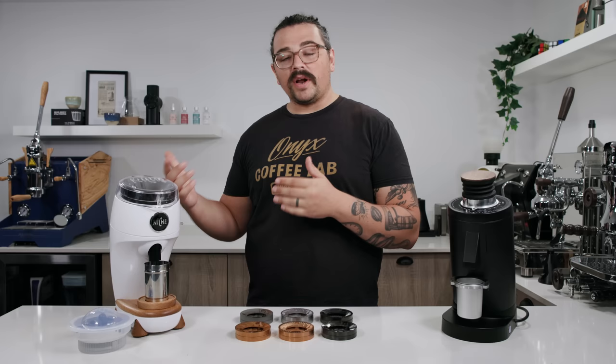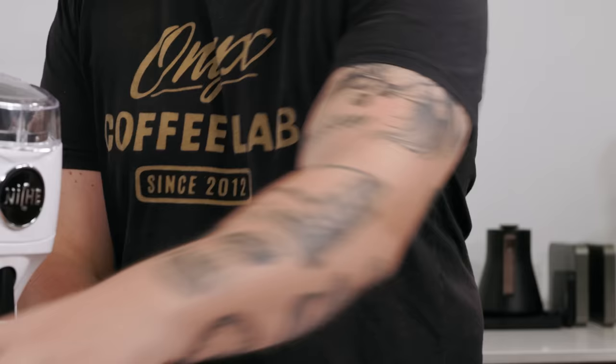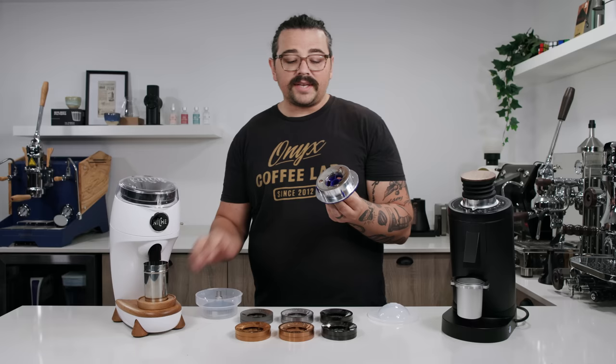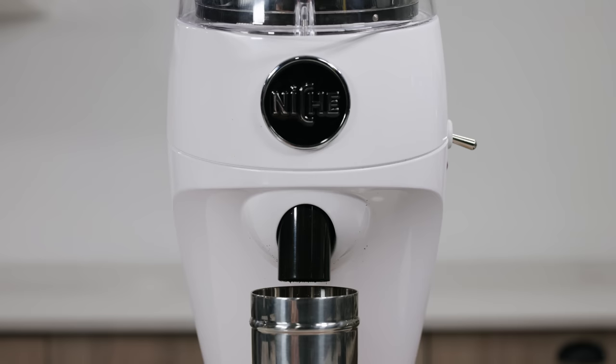What I can see them selling, which would be easy, are just extra burr carriers that you yourself could fit SSPs into. That way you could have different burr carriers to switch out instead of unscrewing burrs every time. Some issues I noticed while using this grinder: one is they don't have an ionizer or plasma generator. Even though it is very efficient with low retention, it shoots out undesirable bits and can get really messy. So you still have a lot of static buildup.